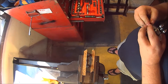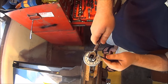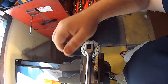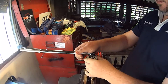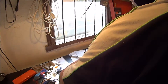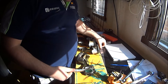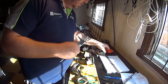Let's reset that to zero. Let's see if we can find something to stick it on on this side. It's gone — probably five degrees already. 65 on both. So that is torqued to spec. Now, zero. About roughly 47. Let's check that. That's about right — 47.